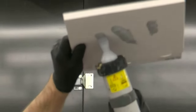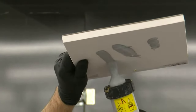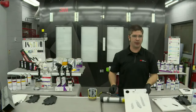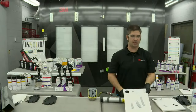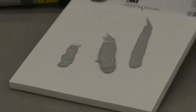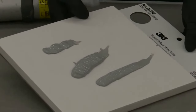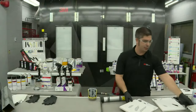And so if I can do this while I'm on camera holding the board, applying it and talking to you guys up over my head, and it's not dripping, falling, or sagging, and I can get that rippled look and appearance, and I put it over a 2K epoxy primer, this is where the strength is going to come in. And this is where we're really going to round out that corrosion protection ability of replicating the original look and appearance. Like I mentioned with that FCA comment, or with that bulletin, we're going to be talking about making sure it's over a 2K epoxy primer, right?